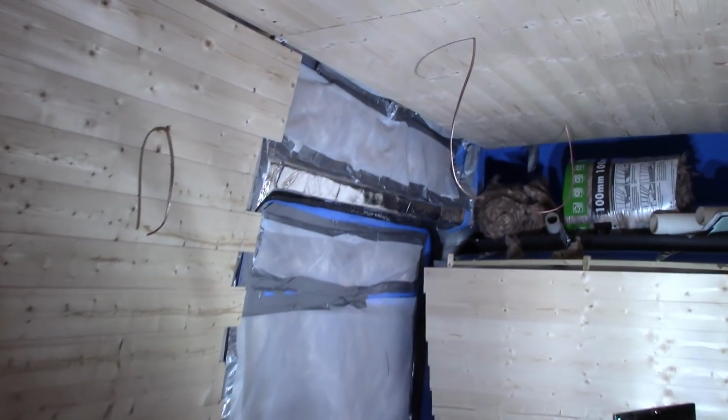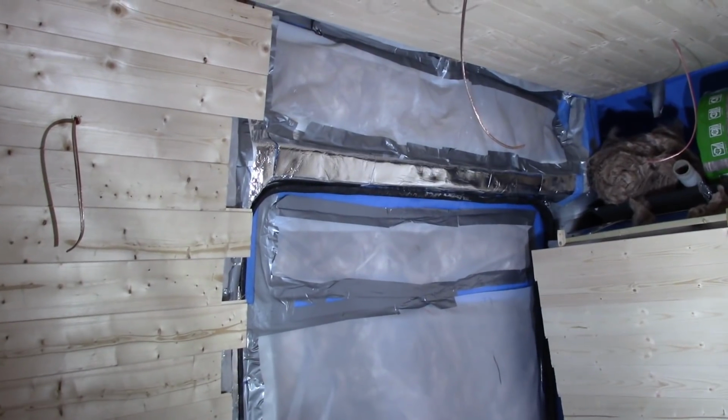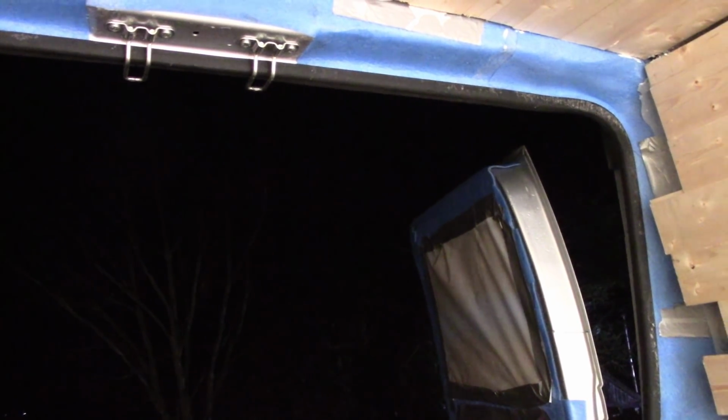we're looking for some rubber seal so we can have a secondary draft excluder, because what's fitted to the van is okay on the sliding door and pretty shitty on the back doors. Those back doors are a bit light, to be honest. When you shut them, they flex an awful lot, so you end up with quite big gaps and a lot of draft getting through. So we're looking for a nice chunky rubber P-seal, so we can attach the P-seal to either the van and have it rub up against the woodwork that we're going to put on the door, or vice versa, attach it to the door, maybe sandwich it in between the battening that we're putting on next and have that close onto the van. But until we get the seal, I'm not going to touch the doors or do any more to the doors.